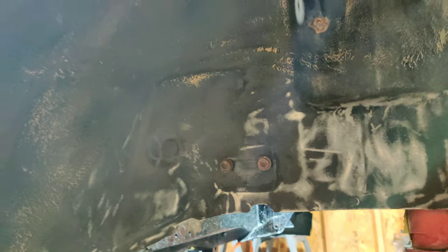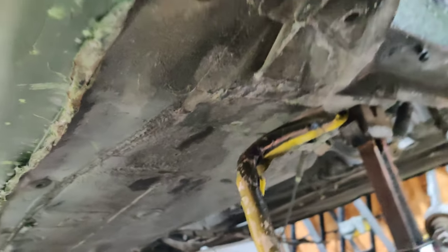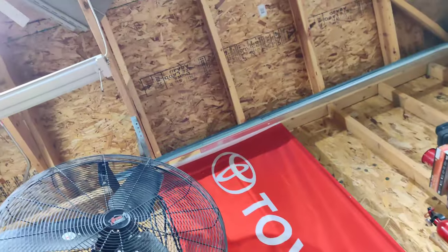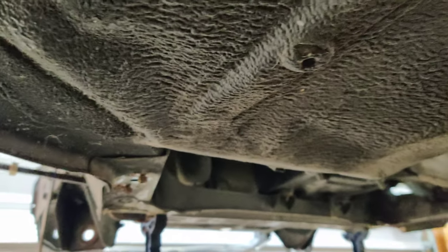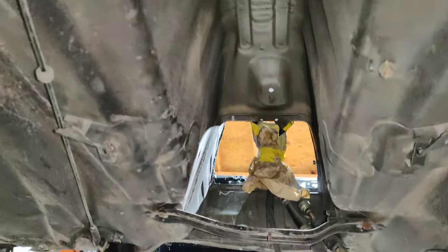I think I finished the rear driver's side — this looks actually pretty good. I'm going to go forward and start spraying some etching primer on this just so I don't have to come back and do that. I'm going to let it dry — just a couple little sprays to cover all these bare spots and anything that I see that could possibly need it. The undercarriage is next. I'm going to try to get on my Z creeper here. So as you guys can see, the undercarriage is not that bad. This is where the fuel tank sits — it's all pretty clean.